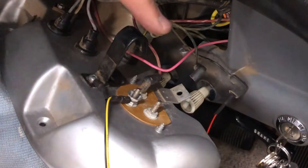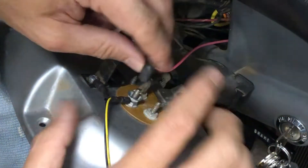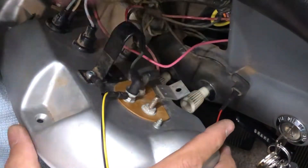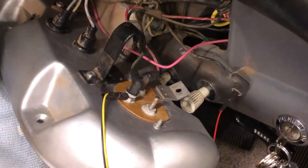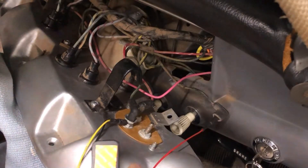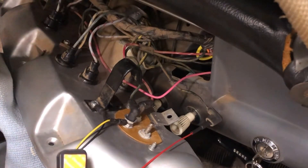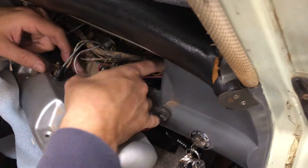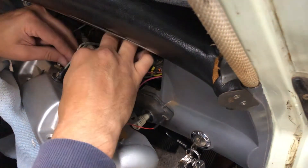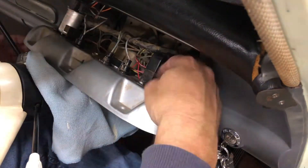So I've got the earth connected, I've got the five volt connected, I've got the 12 volt connected, and now I just need to reconnect the five volt across to the fuel gauge. We should now have power across to the fuel gauge and we're good to go. This new digital voltage regulator does have a self-adhesive backing, so I'm going to thread it in underneath and stick it on the back of the instrument cluster just to keep it nicely tucked out of the way. I threaded it through deliberately before peeling the backing off — and now I'll just stick it down. That looks quite neat.